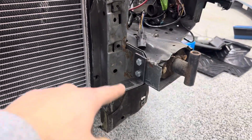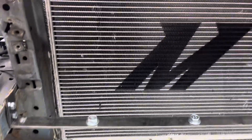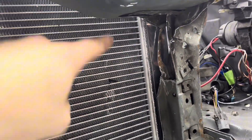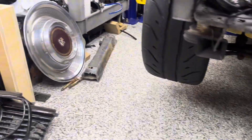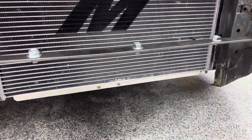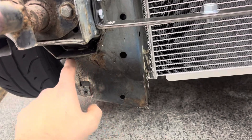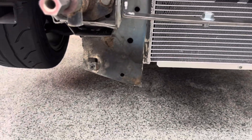I'm going to take some measurements so you guys know, if you want to make a bar like this to mount the intercooler, about where everything can go that'll still clear. For now the Mishimoto radiator will stay. You have to cut out the hood latch area — this whole piece comes around like this, you just make that square — and there's a bottom bar here that you have to cut out to run this radiator, which isn't a big deal. None of this is structural in here. So staying away from the frame rail I'm going to cut all of this out up to about here on both sides.